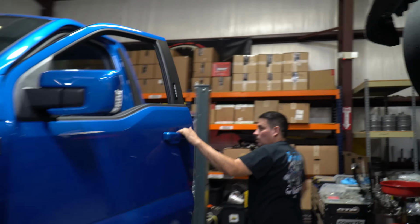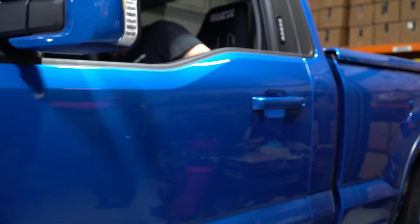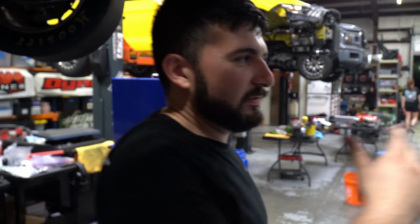Got a little boost leak through the clamp. Test 2, let's go. Alright, so this is a temp with the VS Turbo 6466s on the same boost as yesterday, right? This is the second attempt. The first one got a little boost leak. So we're going to compare the 6262 Turbo Smart to a VS 6466. See what it does.